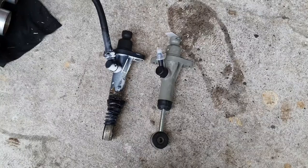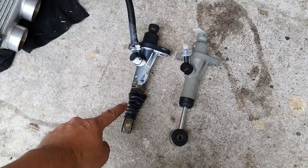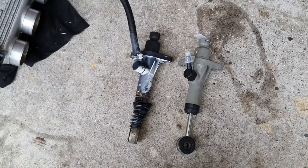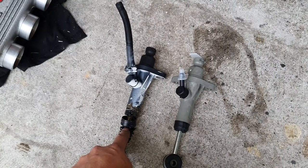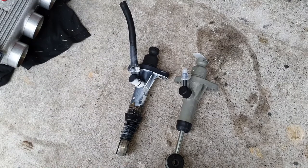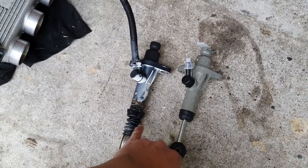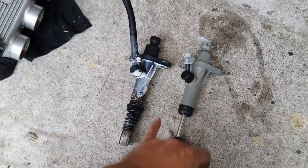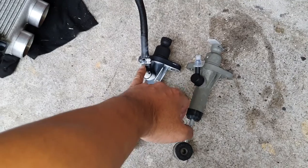Here's the old master cylinder next to the new one. I tried putting various types of grease in there to quieten it down — it helped a little, but you're really just better off changing it. It's not a bad job and it's a pretty cheap component. The new one has a slightly different design: the old one has a big boot presumably filled with grease, but that boot gets corroded and pulls down over time, allowing dirt to get in. The new design has less boot, which should help. We need to transfer the hose line across using the clip or a jubilee clamp.